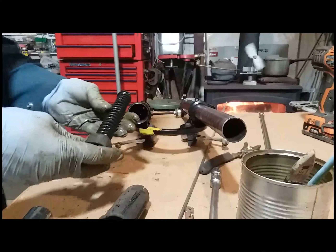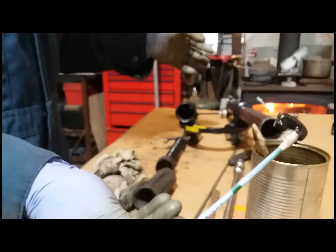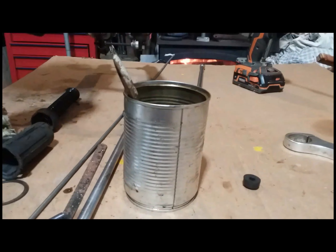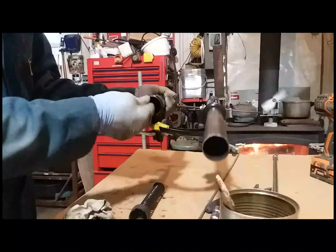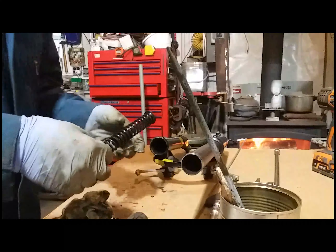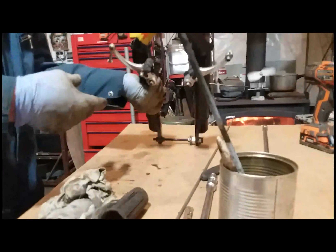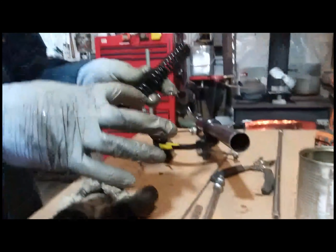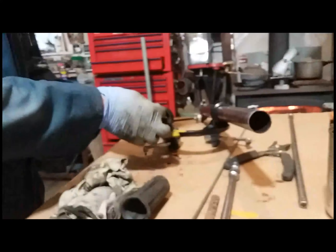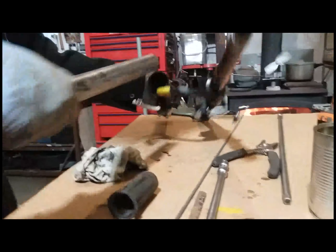That's some of the anatomy of a downhill fork from 2002. Now I'm going to get the parts ready. I like to put a little bit of oil on the spring, so I'm going to use a paintbrush and some oil. I got the bushing, another bushing in the middle, and then this bushing goes on the end. I made a little rag with a stick on the end, dip it in the oil, and I just want to put some oil down in here so everything slides nice and easy.